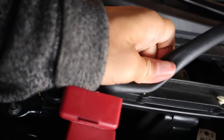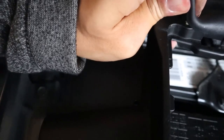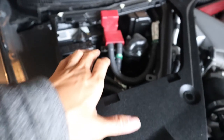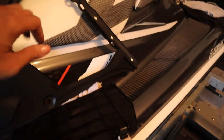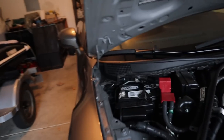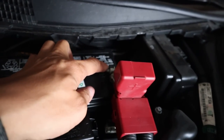I'm doing this one-handed so I can guide you all in a proper way with how to remove the panel. Alright, just push it somewhere to the side. Now we have arrived at the fun part where you actually have to use the ratchet set to remove the battery, because you have a bolt there, a bolt there, and also a bolt for the positive terminal. The ratchet set is a must, and lucky for me I have one right here.